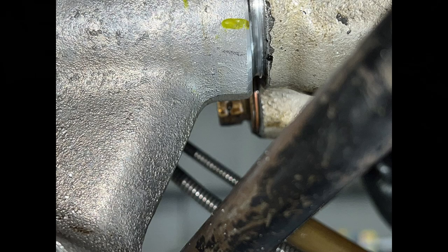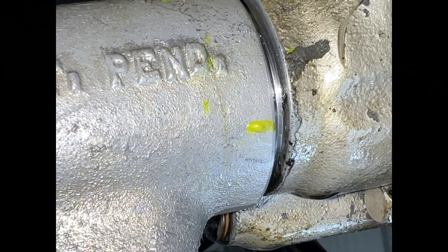Here's the problem I discovered with the original. When you run it into the filter adapter without gaskets it doesn't make up, so it's actually giving you a false torque when you torque it up with the gasket in it. You think you're getting 65 foot-pounds but you're really just bumping up against the threads. I also found that my threads on this old F&M were galled, which contributed to the problem. And here's another shot of it — it's just not enough to compress that gasket enough.